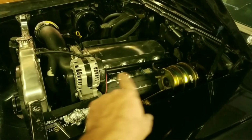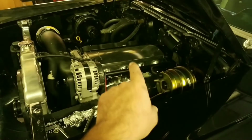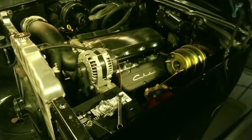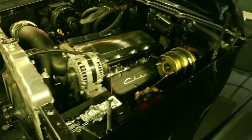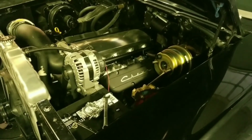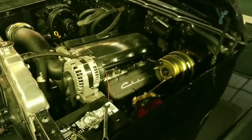So that was a lifter valley plate. Let's see, there was lifters, pushrods, I believe rockers. There's upgraded springs for the cam. Ended up redoing the heads just for the hell of it. We cleaned them up, put new valves, new springs that came with the cam. We did the valve stem seals and got all that done.